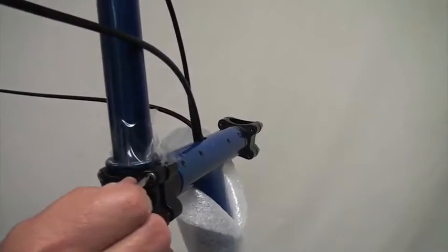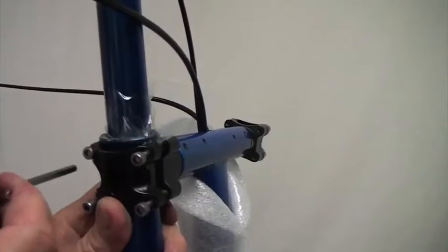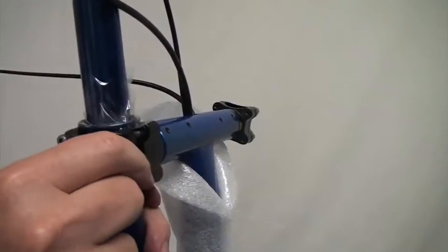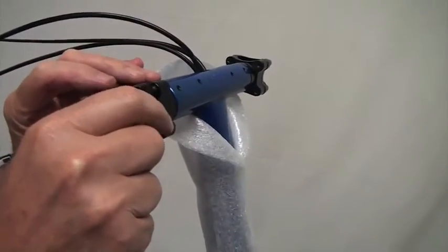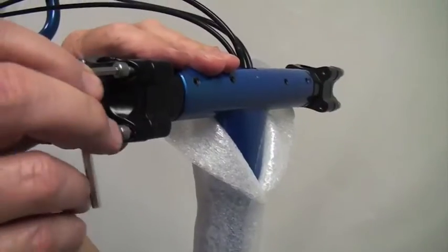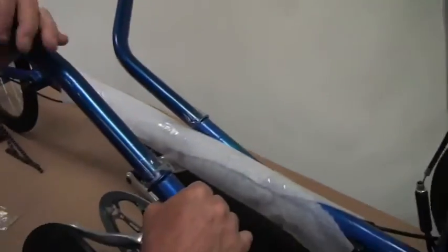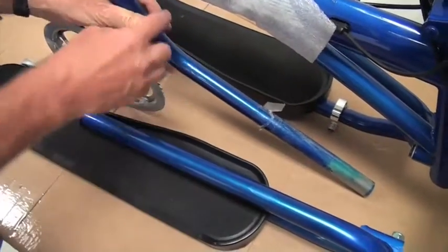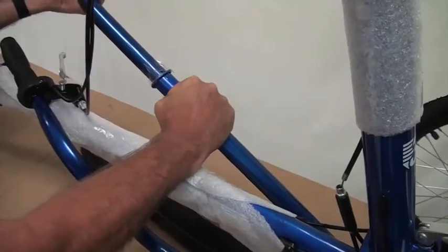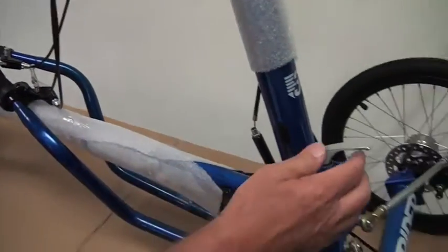Use the four millimeter wrench and unscrew the cap with its four screws. Once all four screws are loose, the cap comes off and the pole is separate — let it rest down on the cables; it won't hurt them. Put the cap back on in preparation for packing, screws back in to secure the clamp cap. Now we're going to fold the head tube down, but first take the inner pole out of the lower pole. Do the same thing on the other side — separate the upper pole from the lower pole. Now we can go ahead and fold this unit.